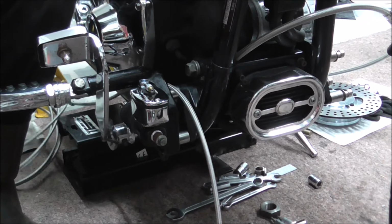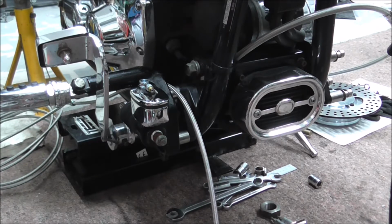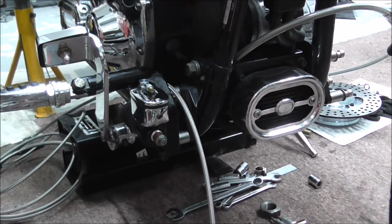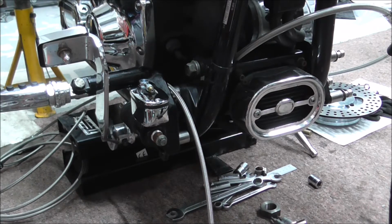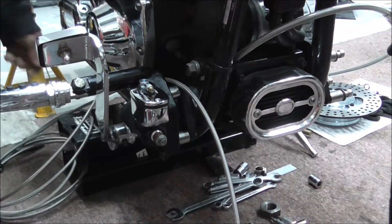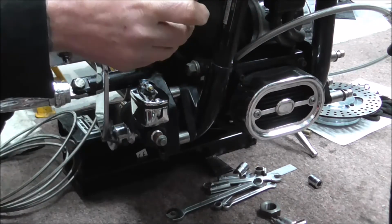So you won't be able to see this bit, but I'm just going to stick my airline on the other end of it, and any dust or bits from the grinding that might have gone up the pipe, just blow it out. Try to watch my fingers on the braiding as well. Right, so that little blast of air will have blown any debris out of the end.